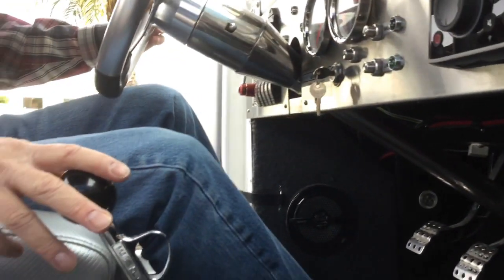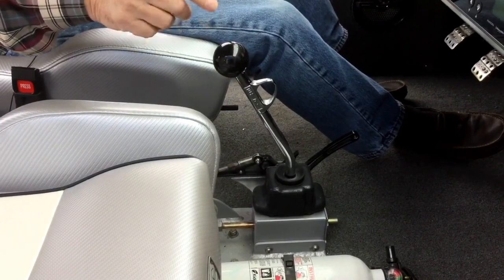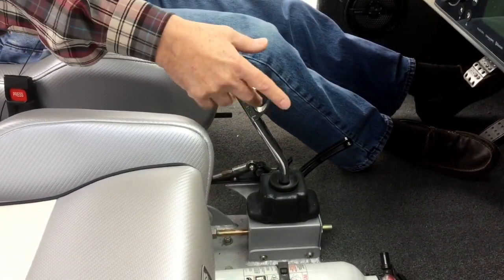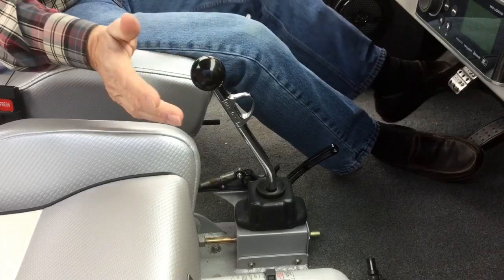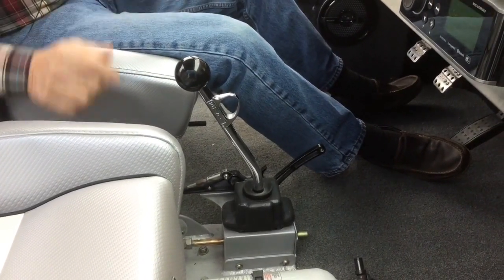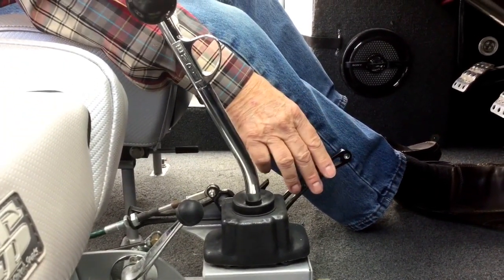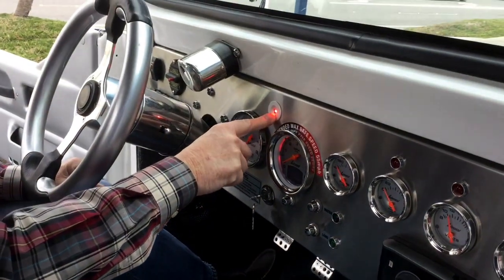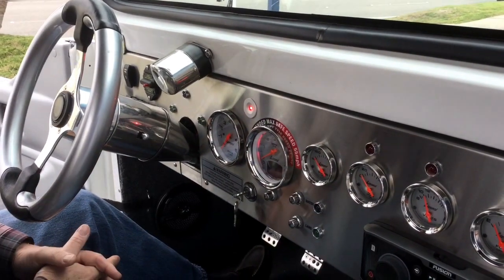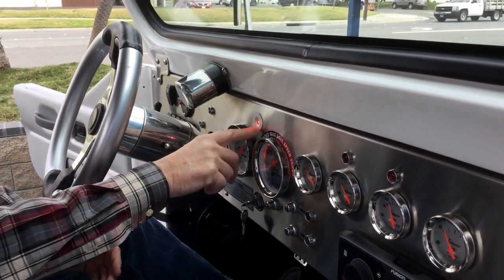Moving to the shift lever — water cars have a standard H-pattern four-speed shift. To get into reverse, you depress the clutch, raise the lockout button, and pull back. Pushing it forward snaps it into neutral mode. The jet engagement switch is really only used when you're in water mode. When you engage it while in land mode, an indicator light tells you that your jet is engaged but your wheels are down. The jet uses water for lubrication, so you really don't want to operate out of the water in this mode for more than 100 yards.